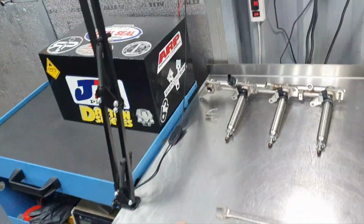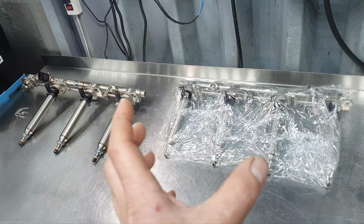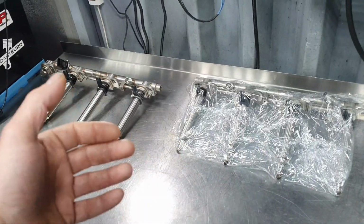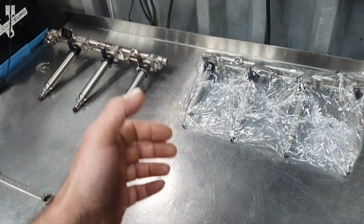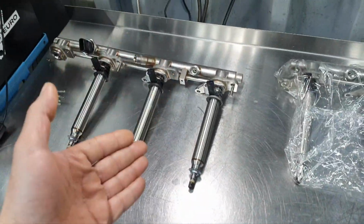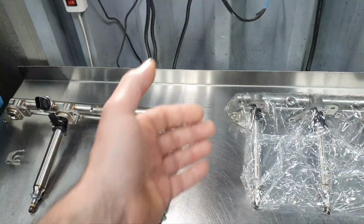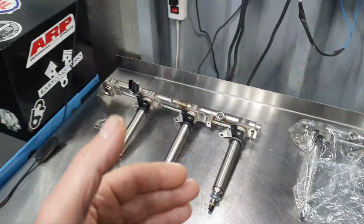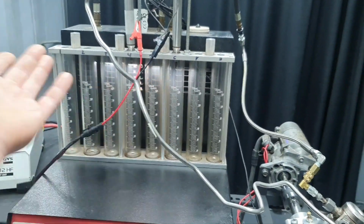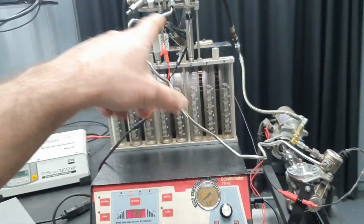It might also be caused by a tighter piston to cylinder wall clearance, so it's going to work harder. It's also a factor for the intake manifold: it has better airflow in one specific cylinder, so this cylinder will run much hotter than the others. Or the back pressure, the exhaust manifold, all this matters. But the injector, you can test it. So now that's the end. Let me continue because I have to repeat the same thing.